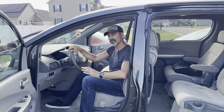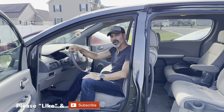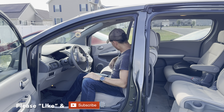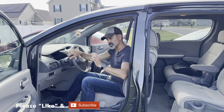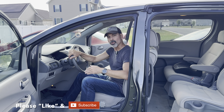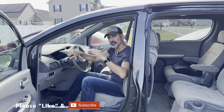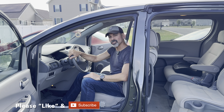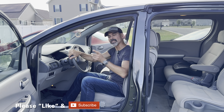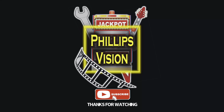Well, that wraps it up. Quick and easy. If you have a vehicle that has one of these kind of armrests that come down and go up, they can be annoying over time. As you use them, they wear out a little bit and start to get loose — it can be frustrating to have them flopping around. That's how you take care of it: just pop that little clip off, and then whether it's a bolt or screw — hex pattern, Phillips screw, whatever — tighten that accordingly, and that'll solve your problem. I hope this video was informative and helped you out with any issues you're having with those armrests. Please send me any questions and comments — I would love to hear from you. And as always, I appreciate all the support. Please like the video, subscribe to my channel. I'll see you next time.